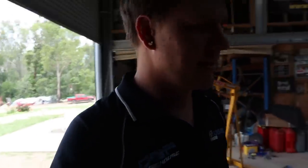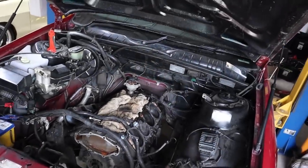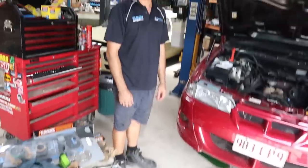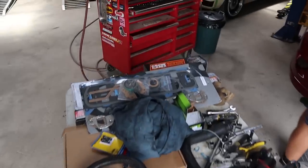Rex has been smashing out this VR — being spoiled working on LS's so often makes everything else feel way more complicated. We've got this thing apart down to a short engine. Rex did find some weird stuff pulling it apart though — the dizzy cap had been put on literally 180 degrees out. Obviously they had the leads to suit, but it meant the dizzy cap couldn't lock into its proper rotating position, so there was no way for the timing to be locked properly. Who knows what the timing was doing — might pick up a heap of power when we get some proper timing in it.